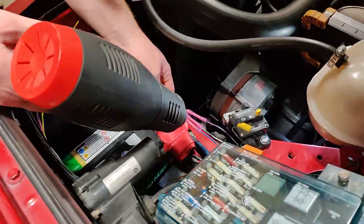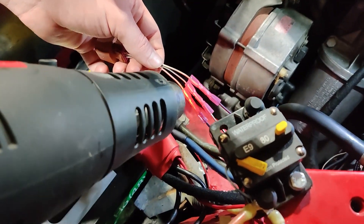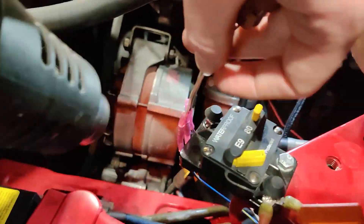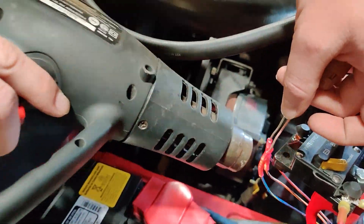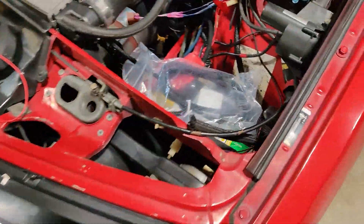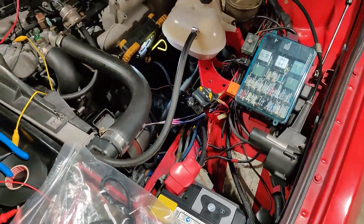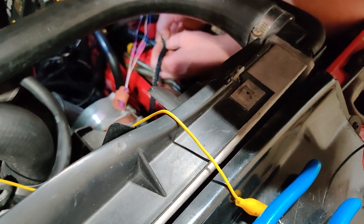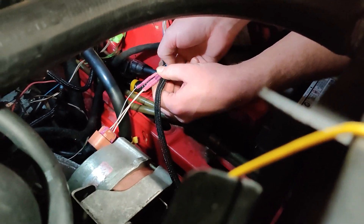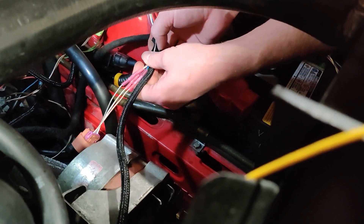Once you have everything crimped up, go ahead and heat shrink it down. You can use a heat gun, or a lighter held close to the fittings to get the heat shrink to crimp down all the way. Make sure you put enough heat on them so they're fully sealed off, so in case you wash your engine bay or water gets close to it, it'll be completely sealed. Then it's time to put some wire loom on there — in this case we've used some split loom. Since it's on a side of the motor that won't get a lot of heat, this is suitable even though it's not fire-rated. Fire-rated styles are significantly more expensive, but this is on the colder side of the motor, away from the exhaust and major heat components.